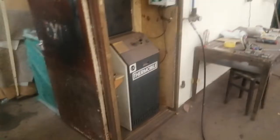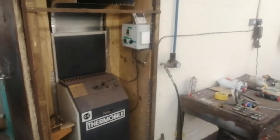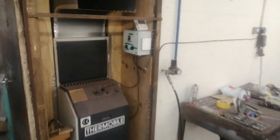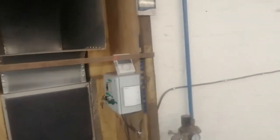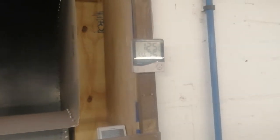Another essential piece of kit — if we go into the paint shop itself — is a heater, which is a warm air blower. This gives us really good control over temperature and humidity. When I came in at the start of the week, we had about 11 degrees Celsius and about 80 percent humidity, which is way too cold and too damp in my opinion.